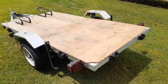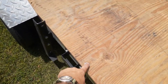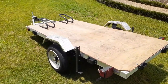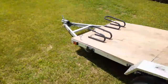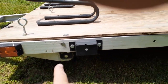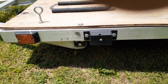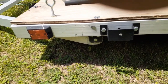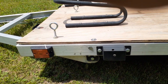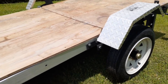I only bolted down the plywood top in a couple places, just drilling through into the rail below. Over those 6,000-plus miles, I did lose a couple bolts — they just vibrated out and fell off. The most dangerous one was this one here that allows the tongue to fold. One of those fell out during the drive, so it was just kind of hanging off there. I caught it one morning when I came out to inspect and it was hanging loose. I happened to have another bolt, stuck it in and tightened it up. You constantly have to check the bolts on this thing.